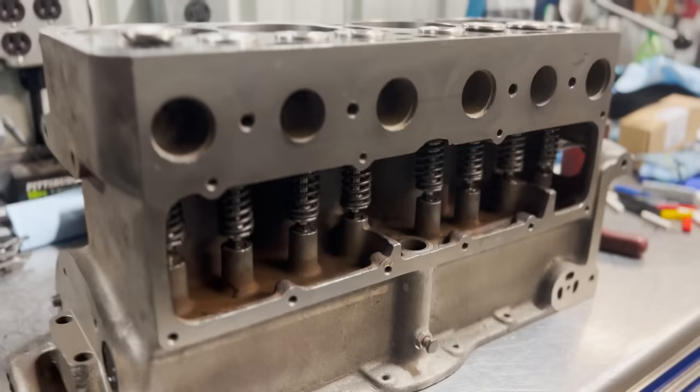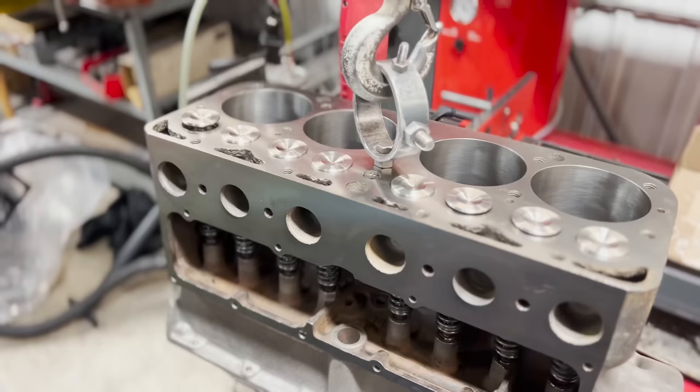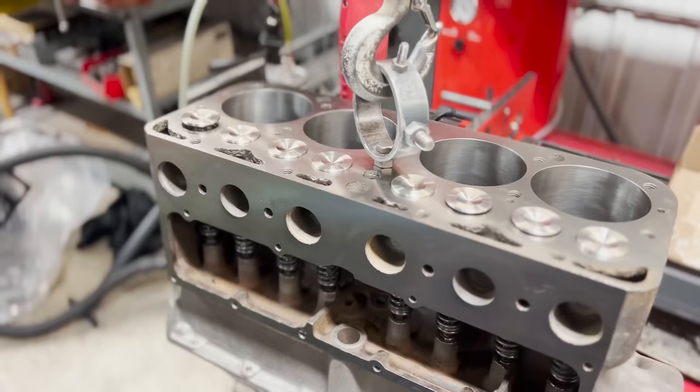And with that, our work on the Ford Model A is complete. To recap: we have somewhat modernized the valve train with the modern valve kit from Antique Engine Rebuilding, we've resurfaced the manifold and head gasket surfaces of the block as well as the head, and we've honed the block for the next oversized pistons. All in all, we're extremely happy with how it turned out, and we hope that you will like, subscribe, and stay tuned for the next video. Thanks for watching.